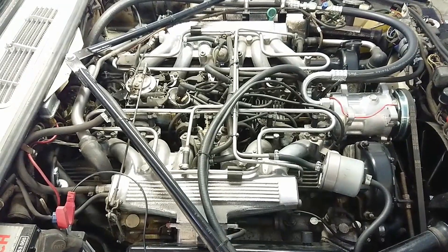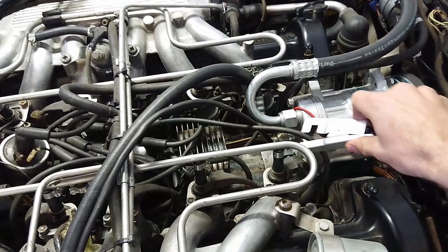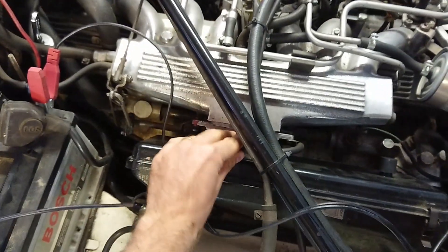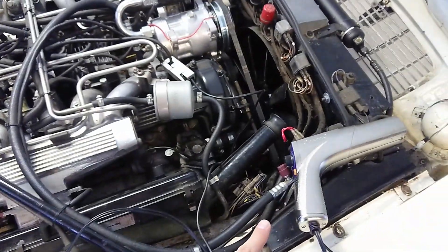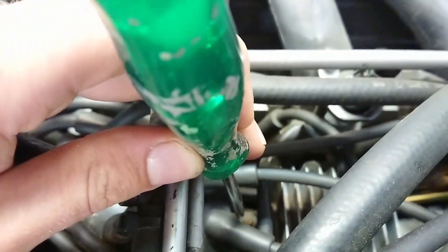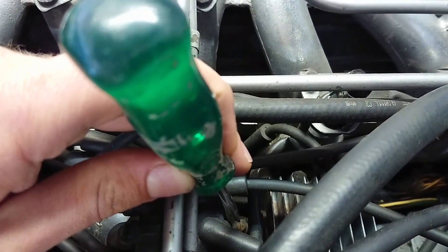Now I'm going to put everything back together and show you how to set the timing. These engines are timed on the first cylinder on the A-bank — 1A, that's this one over here. Grab the sensing part of your timing light and hook it up on 1A. You also need to disconnect the vacuum advance — it's right over here. You can choose to disconnect it up here, which is a little easier. Make sure you've hooked up the positive and negative terminals to your timing light, and make sure all cables are out of the way so nothing goes into any of the belts or the fan. Also, it's a good idea to check that you have a good screwdriver that fits down here — there's a tiny flathead screw with a locking nut where you can set the timing back and forth.